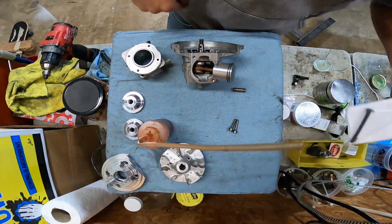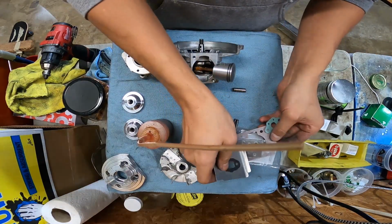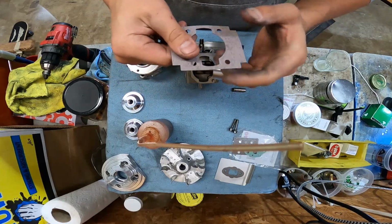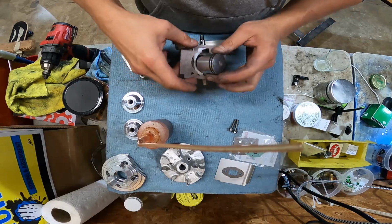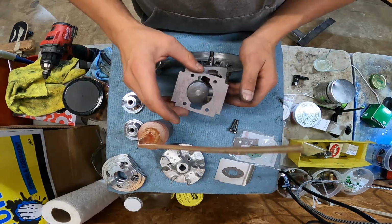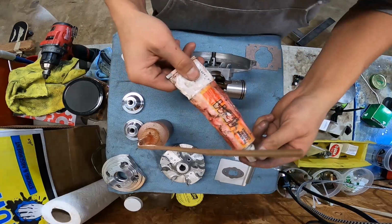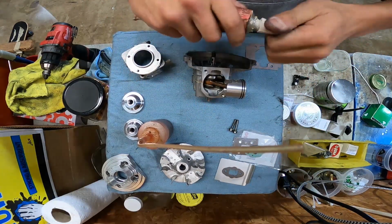Cylinder base gasket, where we at? Where's all the gaskets at? I'm using all DDM Racing gaskets on this. How does that gasket look? So I think I'm using a set of RC cases. Looks good. I like 1211 everything. 3-bond 1211 liquid gasket sealer.